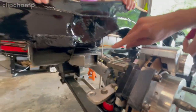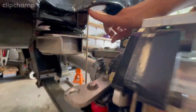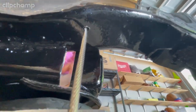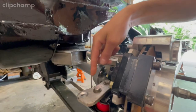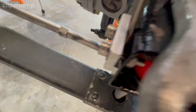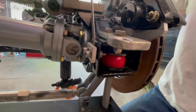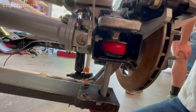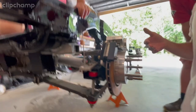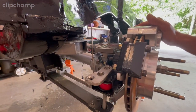If you look in the bottom right here, you'll see I drilled a hole into the frame and dropped a cable down through there, then just created a quick little bracket. Come around the other side and you'll see I made this little clamp bracket so that I could adjust it and get it right. I've got it stopping the trailing arm before it gets to the binding point.